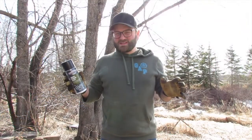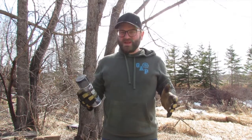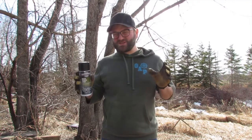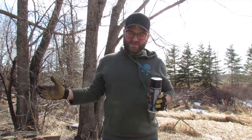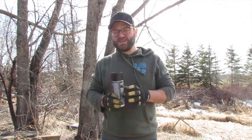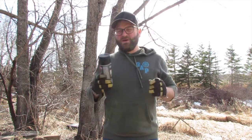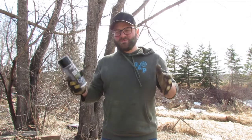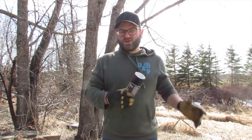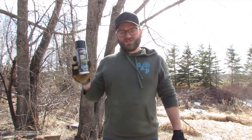You might be wondering at this point why I haven't mentioned fogging oil. Well, that's because personally I don't use it, and that's mainly because our summer here in Canada is so short and our winter is so long, so it's not really worth it because I'm going to be using the snowmobile in a few short months, and it does make the snowmobile very hard to start in the fall. However, if you live in a part of North America where obviously your summer is longer and your winter is shorter, this is a viable option as it does prevent your engine from seizing.